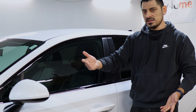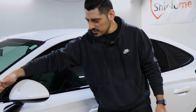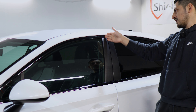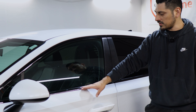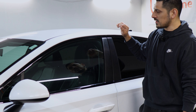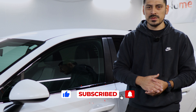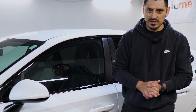That concludes the installation video for the chrome deletes for the grill and windows. As I said, there's not really a correct way to go about it — it's just placing it how you like, making sure it's aligned, and then trimming off or tucking in any excess material. Make sure before installing that everything is clean with no dirt or contaminants on the chrome, because if it's not clean the material will start lifting over time even after you apply heat. We hope this video helped you out with the installation. Please give the video a like, subscribe, and turn on the notification bell so you don't miss any upcoming installation videos. Thank you for watching and we'll see you in the next video.